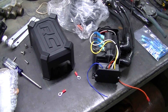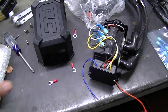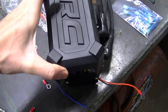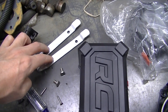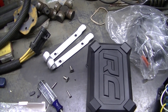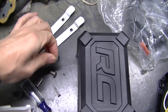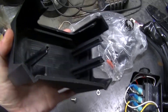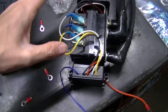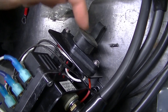I have videos on everything you can check out if you want. I'm just trying to get my wiring all sorted out. This is the little control box that's usually mounted on the winch. This goes over and covers all that up, then you've got these brackets right here that actually bolt to the winch. I didn't have enough room — my radiator support was in the way — so I had to take this off. In order to get this plastic cover off, you've got to take these off, which are mounted with these bolts. Then you've got this piece which has got three screws. It screws down to this plate here, and right here is where you plug in the Rough Country controller.